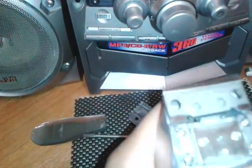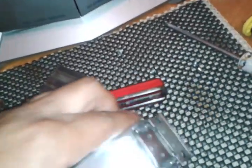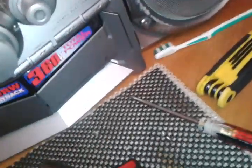I removed the comb blade off and still had a cutter blade on it. And this is the way you want your comb blade to be, snug. It's on that snug, and I'm popping it off now. You see how I just had to pull it away. If you take your comb blade off and your cutter blade just falls off, that will cause a lot of vibration in your clipper too.